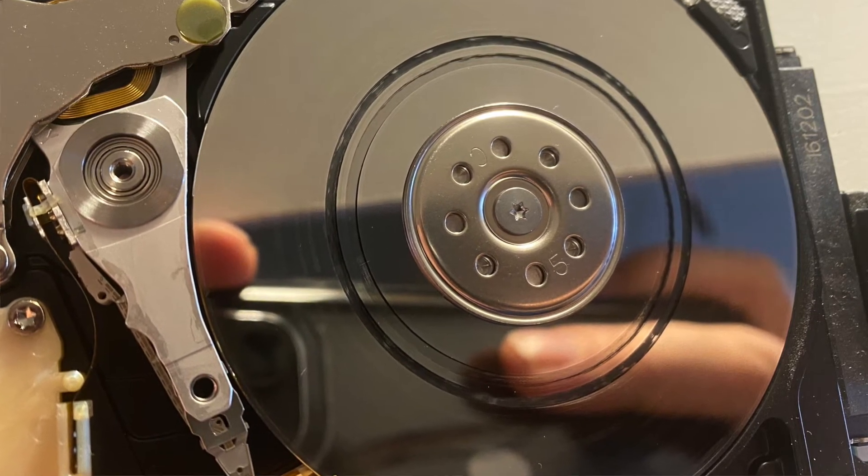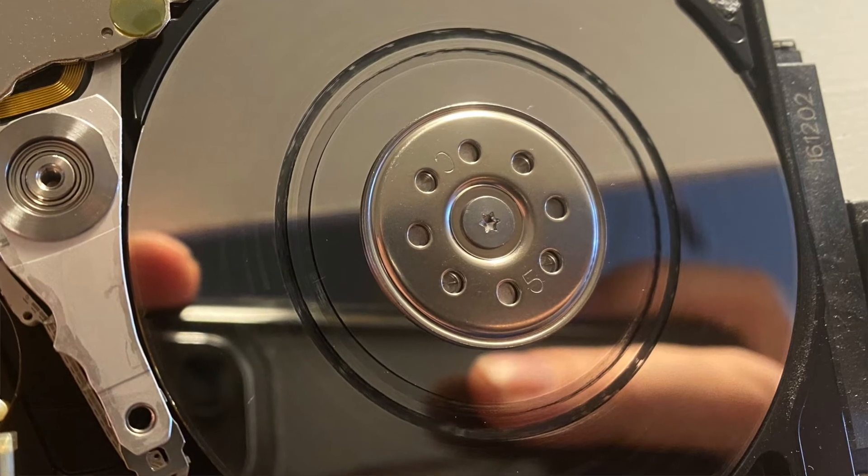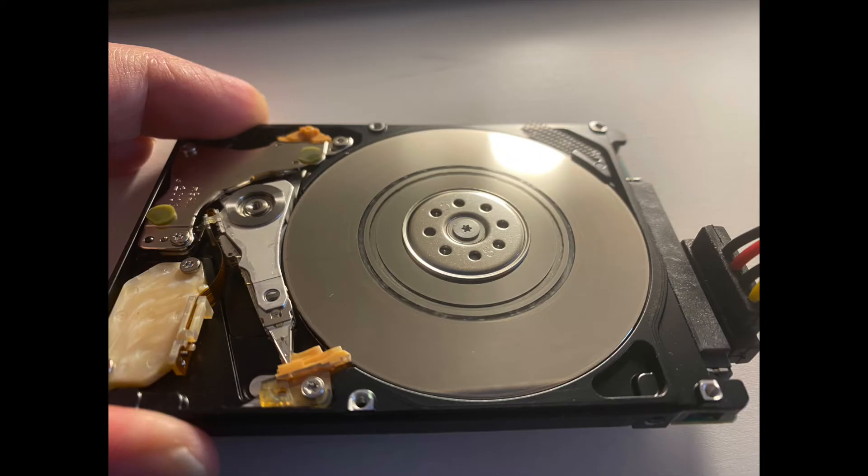I'm going to play the clips out of sequence from the order that I recorded them. The first clip that I recorded will be played as the second clip, and the second clip I recorded I'm going to play now — it captures the boot sequence of the Mac Mini. I had to rest the phone on top of the Mac Mini and press record, so you'll hear a bit of a scraping sound. I was positioning the phone to get a good conductive audio recording. Then you'll barely hear me press the power button, a short pause, then a chime — that's the Mac saying it's starting up. Then there's a short pause before the hard drive is asked to read content off of the drive, but when it is asked to read, it's going to have some problems, and then you'll hear some ticking sounds.